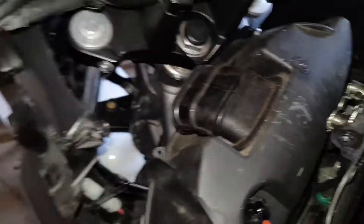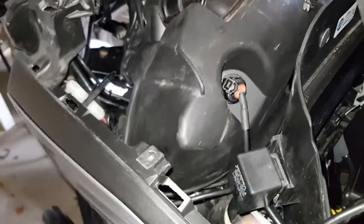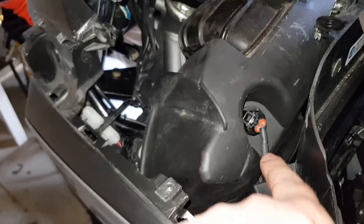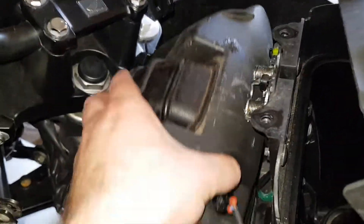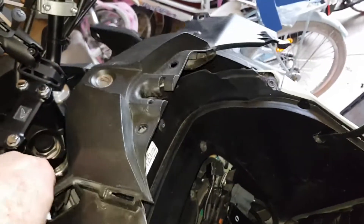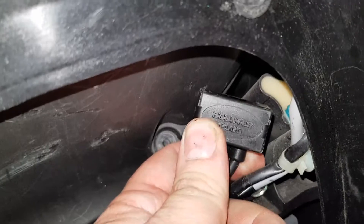If you need to replace the air filter element, pull it all the way out and replace it — I'm not doing that now since I've already done the work and I'm just showing you my install of the booster plug. There is the original cable attached to the air temperature sensor here. I have already attached the new one from the booster plug — it comes ready as a harness, just plug and play. So you pull the original off, put the new one in, and then the original goes into the booster plug harness, which I pushed down through this small gap here. That gives you the opportunity to tuck it down behind the service lid. And here you can see the original harness going into the booster plug harness, and the booster plug controller is this little square thing here.